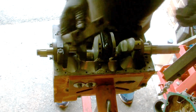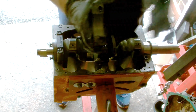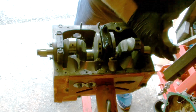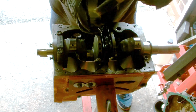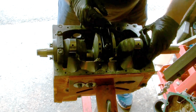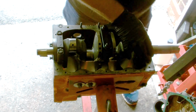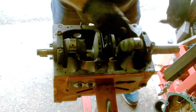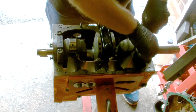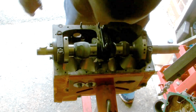Okay, last cap. End cap. Press the bearing into it. Give it a bit of a clean off. A bit of lubricant on here. You don't need loads of this stuff, but it just helps. Put it on there, give it a bit of a tap. Two bolts. Just do these up finger tight. Okay, right, in the next bit I'll be doing the torquing sequence.